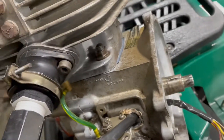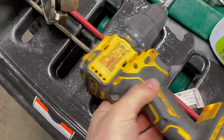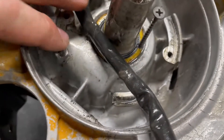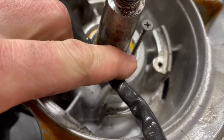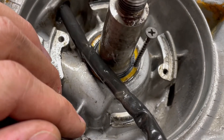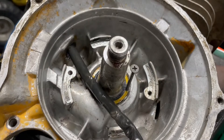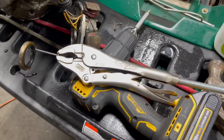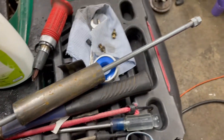I'm going to try and replace that seal and check it again. The method I use is just a drill and a screw — because I don't have a helper today — just screw it in, you don't need to punch it or anything. Just start screwing and it'll eventually go in, then take a claw hammer or pliers and pull on it and the seal comes right out.